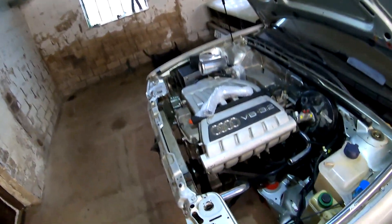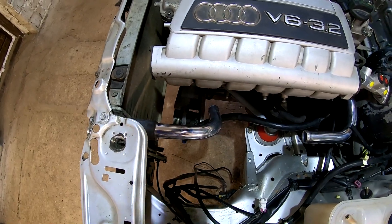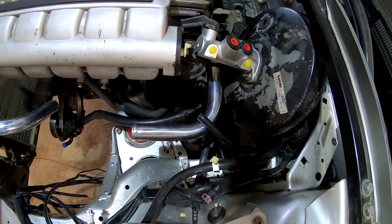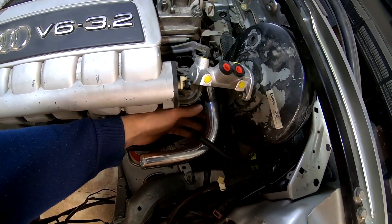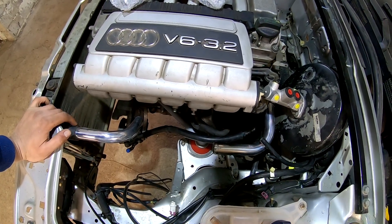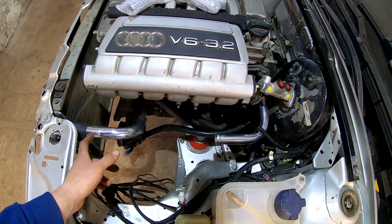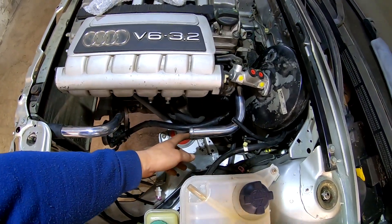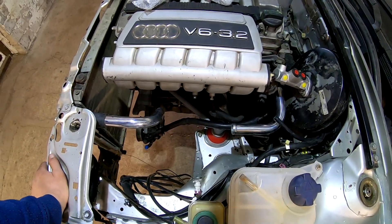It comes here on the driver side radiator mount, and I think it will be interesting, so I'll show you a little bit. This is a radiator connection — it's only test fitted, it won't stay like this. And this is a thermostat housing outlet. I ordered a reducer that will arrive, and here also I did order a nice silicone coupler — right now it's here only for test fit. The idea is I cut this pipe here somewhere, and then here comes also a 90-degree bend, and we can have one bracket here under the intake manifold. So it sounds easy.